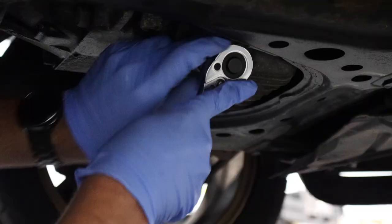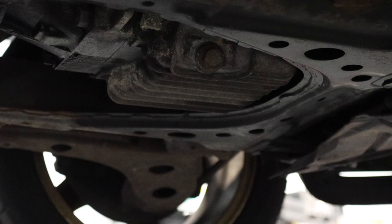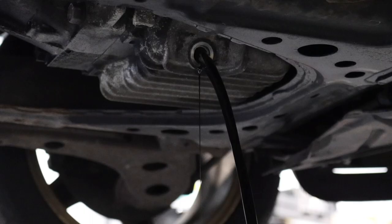It's best to get the car warm before doing the work so it will be easier to get the oil out, but the oil could be a bit hot, so best to wear gloves or some protective equipment. Using a 19mm socket, I undid the sump bolt, which was stiff but thankfully not too stubborn. Whilst that was pouring out, I moved on to the diff.